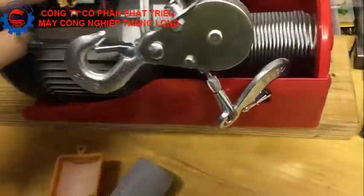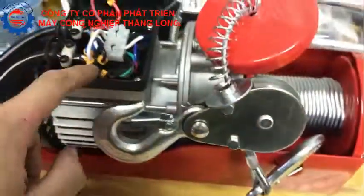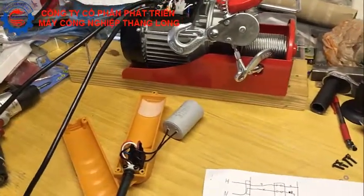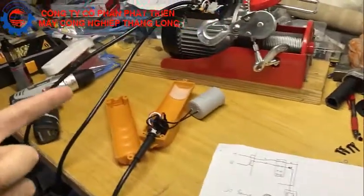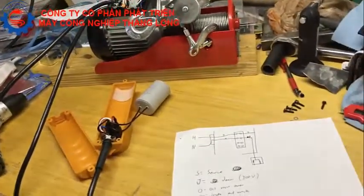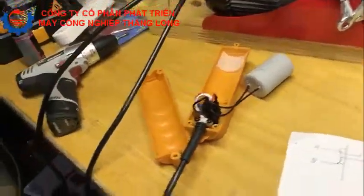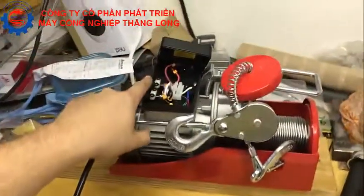When you open this up and you're getting ready to swap it out, you can see where the hot line goes straight into the terminal block and out through here, and you even have your motor startup capacitor. It's like a built-in extension cord that goes into the unit and comes back out. Gauge your wires for your length just like an extension cord — this is about four and a half amps, so 16 gauge is fine for an extra 30 feet. Use those extension cord charts, check the amperage for your unit and how much you're extending.